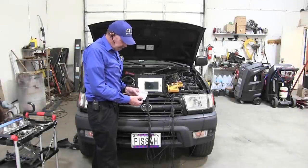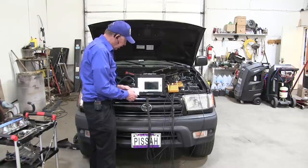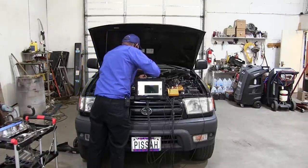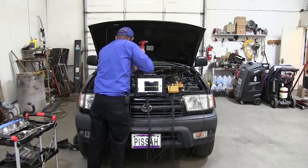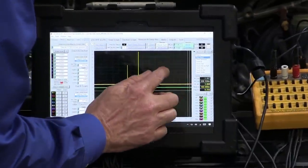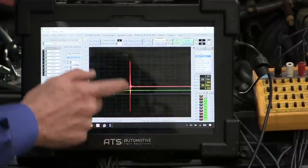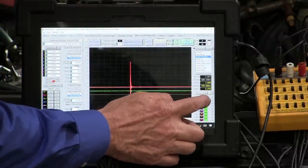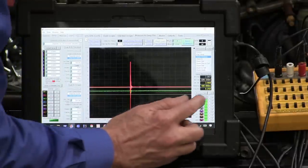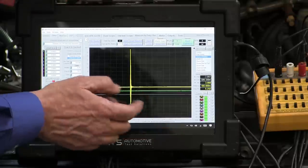I've got a sensor from Toyota — actually it came from Worldpack — it's a genuine Toyota sensor and I've got it installed. I still have a 20K load on each one. The yellow one is big now. What a difference — now bank one is bigger than bank two. That's so cool, but now I'm worried about the other aftermarket sensor on bank two. That's an AutoZone sensor versus the OE sensor from Worldpack — look at how much bigger the amplitude is.